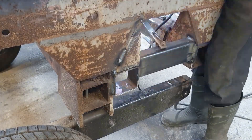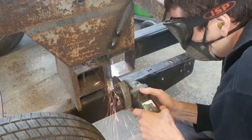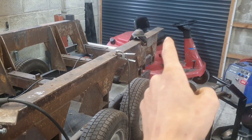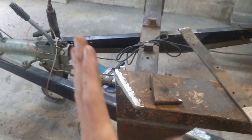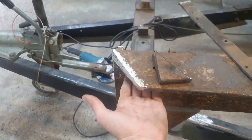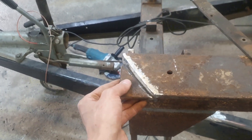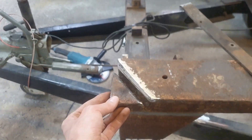I need to fill in this gap here with a flat plate, which I'm going to cut. Luckily I have a lot of flat plate having cut quite a bit off the rolling road to save a little weight. That blasts on there nice and thick and I've put some chamfers on it so I can really get a lot of weld in there — that's going to form where the rolling road leg is bolted. Now I'm going to show you my mistakes. I cut the corner off the back and front of the rolling road which I thought neatened it up beautifully, but of course I'm now putting a leg there and all the weight would be taken by this flange. I don't like it — it's going back on. That was a pain and now I've got to put the thing back on.